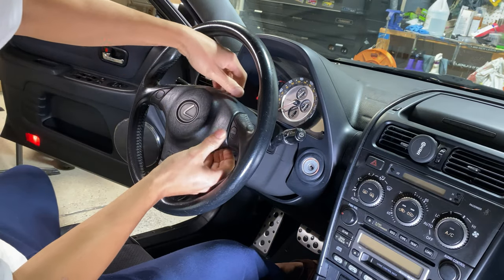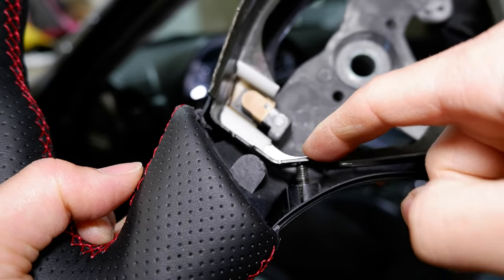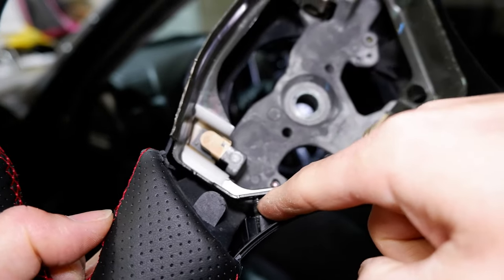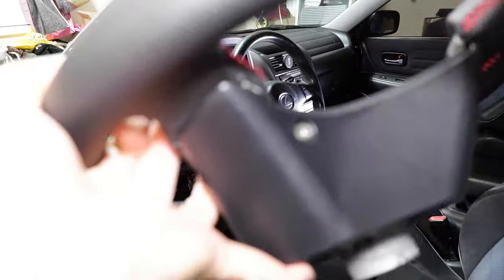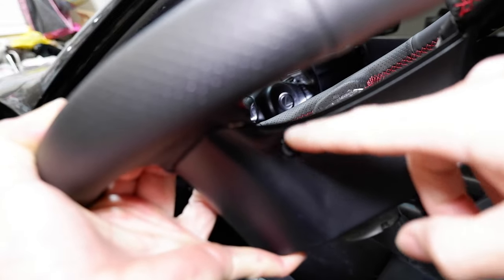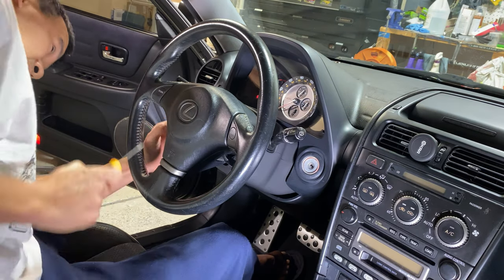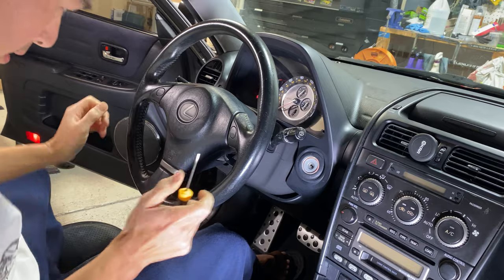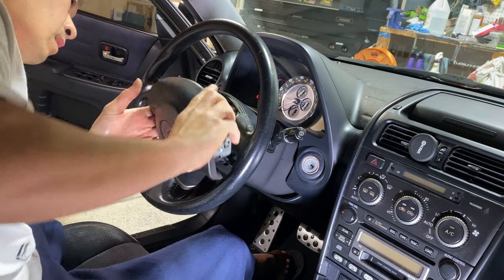Once you do that you just pop the airbag off. As you're unscrewing the airbag screws, you'll see the screw stays in there a bit — there's a little of it that still hangs into the actual airbag. So you've got to pop the whole screw out where it's being held by the retainer. You take a little flat head screwdriver and pop it out so it clears, then pull the airbag out. Just pry the little plastic and it pops the screw out, and the airbag pulls right out — then just unplug it.